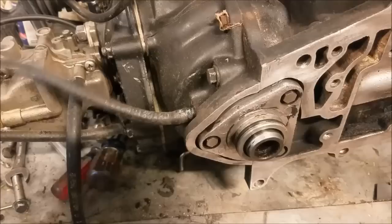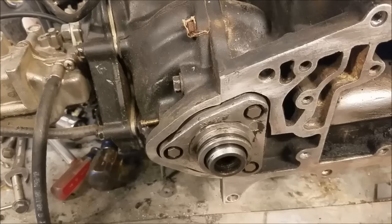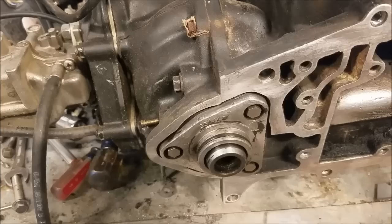As this was a military motor, the bottom crankcase hose went to the dewatering valve. I will not be installing a dewatering valve, so basically I'm demilitarizing this motor. To do that I need to install the proper hose on the bottom while the power head is off. I probably won't mention much of this later on since very few people have these military motors. Either way, swapping out the lower hose — this is a standard 5/32nds hose. There's the hose and part number for it if you want to get one for yourself.